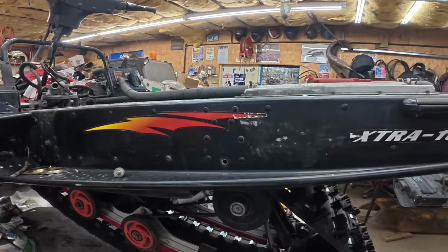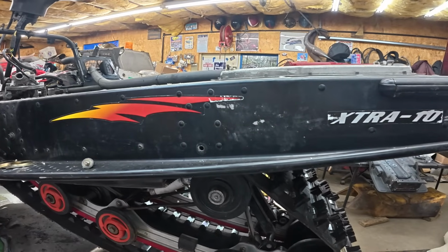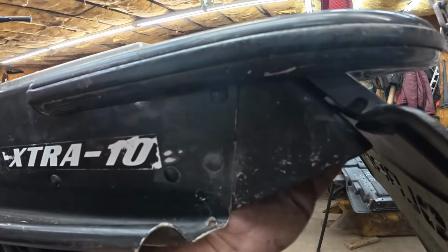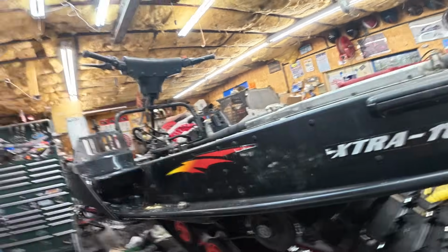So, problem solved. I did have to drop the back bolts out of the skid in order to get those tunnel protectors out. If I didn't, they just sort of rammed into the close off here. So, all good. I guess next step is drill a couple holes, shorten them that much, and put them back in.